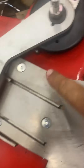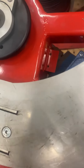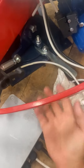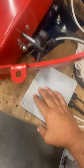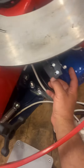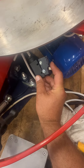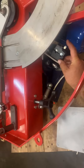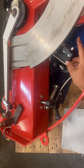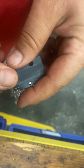Step one: your machine is cocked. See the micro switch — it goes right there. Take it out, pull it down here like this. Notice my arm is under here. Turn the machine on and you'll notice it is cycling while the arm is staying still. What you want to do is make sure that micro switch turns off your motor. If you squeeze the micro switch and the motor turned off, you're fine.